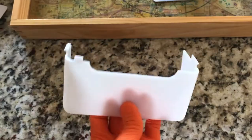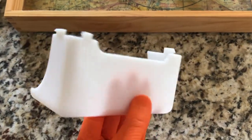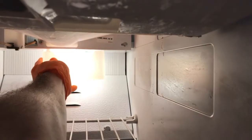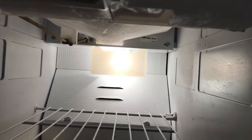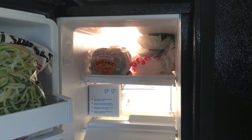Wow, that's really nice. Here's the plastic protective shield that protects the light bulb. Two clips on the left-hand side, one clip on the right — this should be fairly easy. Insert the right prong first, then insert the left prongs, and that is in and secure. It's pretty bright — actually brighter than the one up top. So what I'm going to do is remove that one and insert an LED bulb there too.